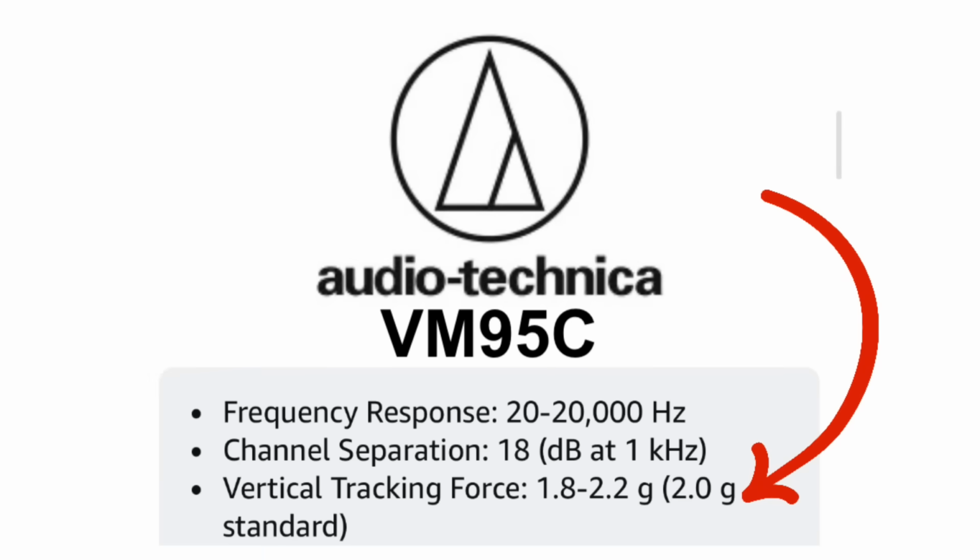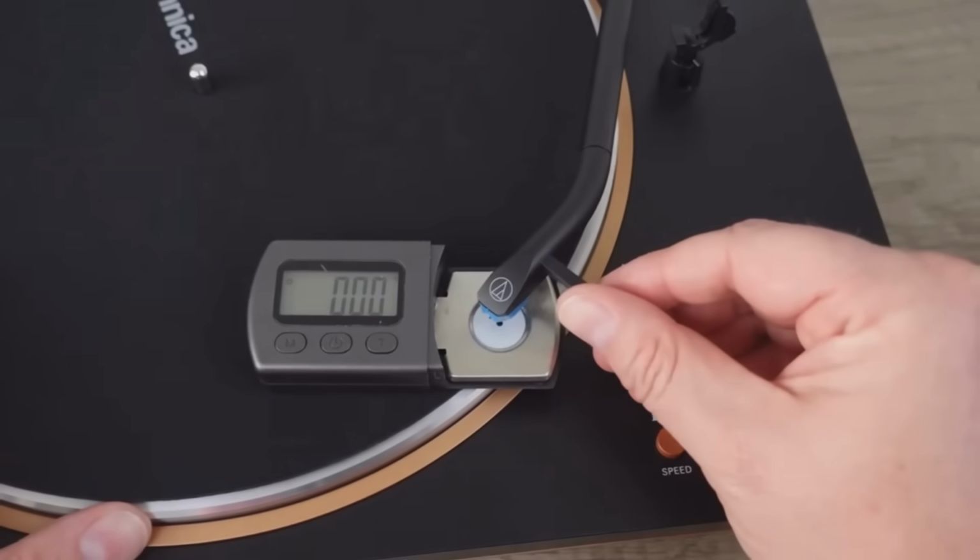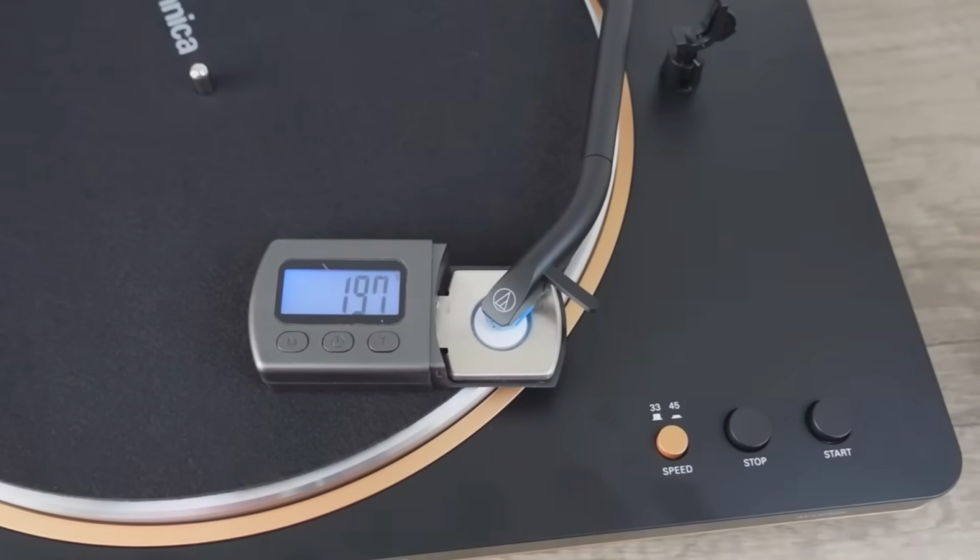What is the problem? The tone arm, the cartridge has a specific tracking value. It should have a certain amount of tracking force applied. As you could tell from our original video, which I'll link down below, this one spec'd out fine. It was on the lighter side, but it was within range. So you can expect skipping issues from a cartridge that's tracking too light, outside of its range. But if it is tracking within its stated, published, specified range, then you shouldn't have any problem whatsoever.